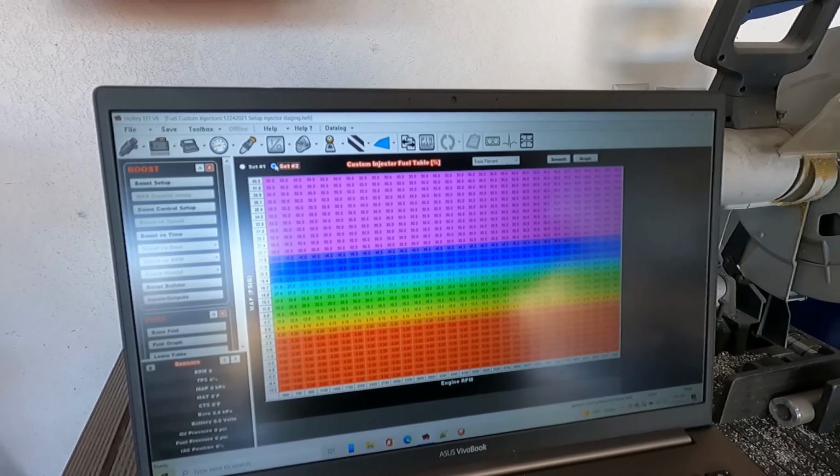So today, we are going to test boost control on the brake, and we are going to test the secondary set of 16 injectors to make sure that they are coming on like they're supposed to. So what I've done is I have adjusted the percentage table in which they start working. So I'm gonna turn the camera around, show you guys that table and how it works, and then we're going to warm Bob up and put him out in the driveway and test him out real quick.